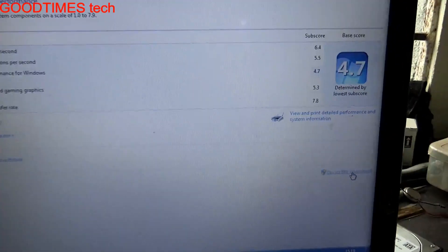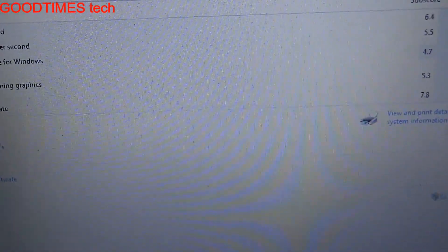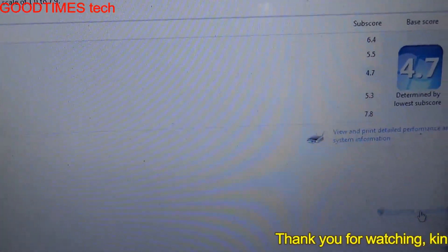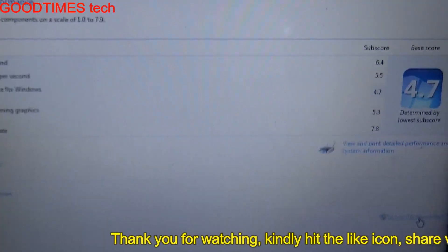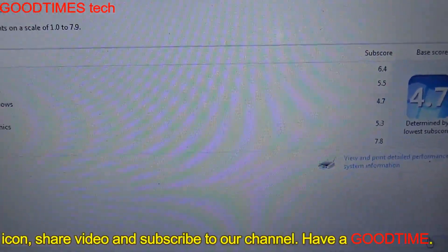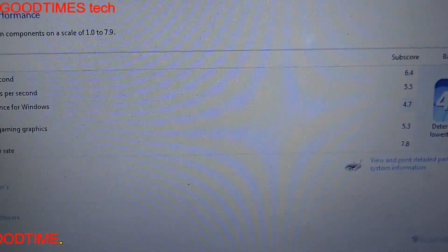So we can go ahead and use an SSD in the secondary DVD bay. However, if you install the operating system on the SSD, the performance will be very good. If you install the operating system on a regular hard disk drive and use the SSD only for data storage, the performance won't be as good — only the copy, read, and write speed will be higher, but Windows working performance won't change much. Hope this video was useful. If you liked it, hit the like icon, share the video, and subscribe to our channel if you haven't yet. Thank you for watching, everyone!